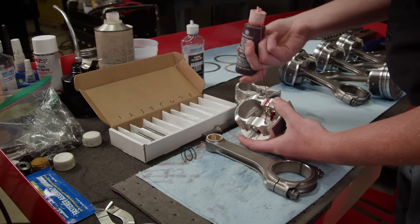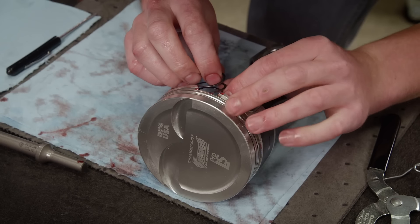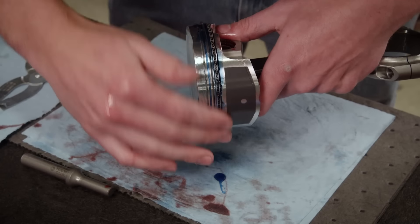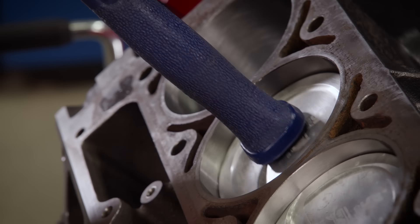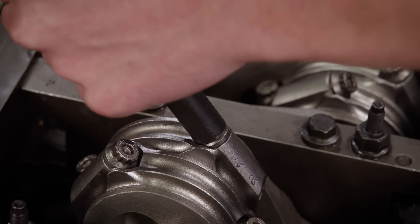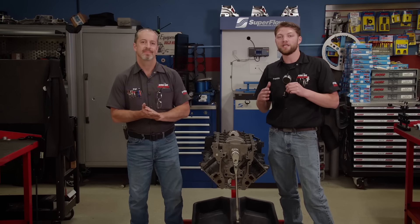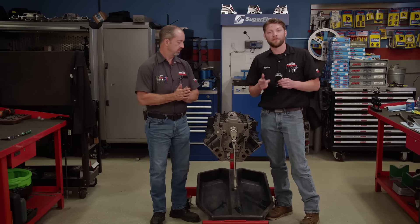To assemble the rods and pistons, we slather on assembly lubricant before slipping the wrist pin into the bore. The wrist pins are held in place with high-performance spiral locks. After installing the oil ring support rail, the rest of the ring pack can be put into place following Summit's instructions. The pistons receive a coating of Total Seal assembly lube and are tapped into the block with a Summit adjustable piston ring compressor. The rod bolts are torqued to 82 pound-feet, and to ensure the bolts achieve proper clamp load, we'll check the rod bolt stretch with the ARP gauge. I always feel way better once the rotating assembly is bolted into the engine — it means we're making actual progress. These Summit Pro-LS rotating assemblies are awesome, always go together really nice, and they're not going to break the budget.